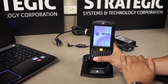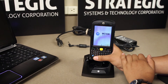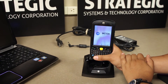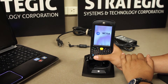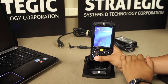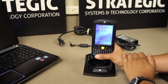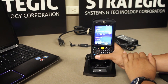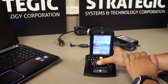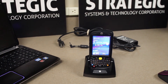The MC55A splash screen will appear on the display for up to 10 seconds. The blue banner will display on the screen for up to 5 seconds. The OS will power up and you can test the device for proper functionality. And that is how you perform a cold boot on an MC55A.